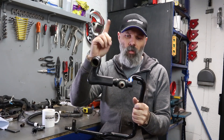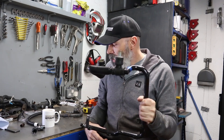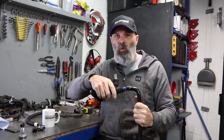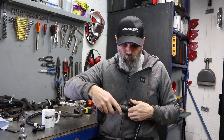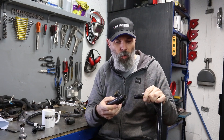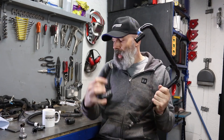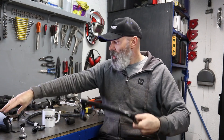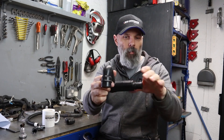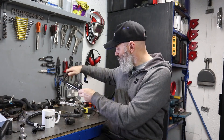So we're coming off the crankcase into the PCV valve, and then we've just got the hard pipe which comes around the other side of the engine, which has actually already been modified. The easy option would be to just connect that directly, but I'm quite keen to get rid of this little plastic bit. It's got really brittle and broke in the existing one — the whole thing cracked — so I'm quite keen to replace that.